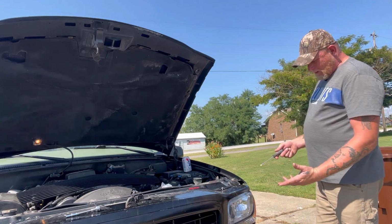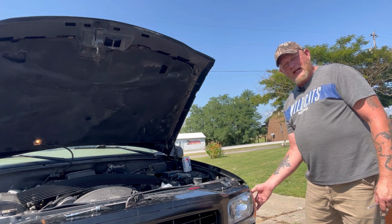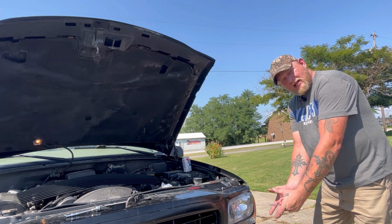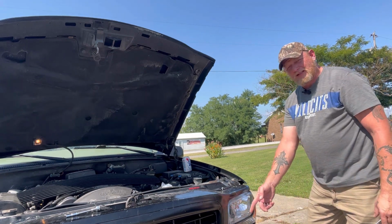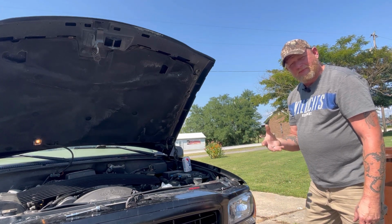So on these corner lights, you've got a Phillips screw, top, bottom, on the side, next to the grill bezel. You pull these screws out, you rotate it out like this here, and there's a clip behind here, and it slides out. Don't try to rip it, because you'll break the tab, and then your lights will look like flipper.